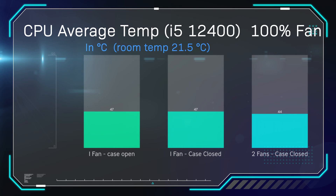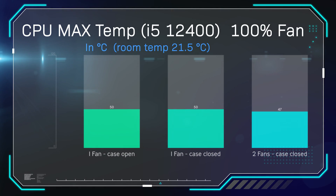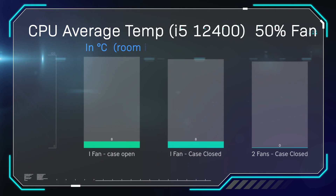So we swapped over to an i5 processor — the i5-12400 — to get a better idea. It performs a lot better with this chip. If you're looking at purchasing this cooler, I'd suggest using it with an i5 or lower, or possibly an older generation i7. The new 12th gen and 13th gen i7s have pretty much no chance of being kept cool enough to make it worthwhile. With the 12400, even at maximum temperatures we were only around the 50-degree mark. Adding an extra fan cooled it by another 3 degrees, but given the extra noise, is it really worth it?